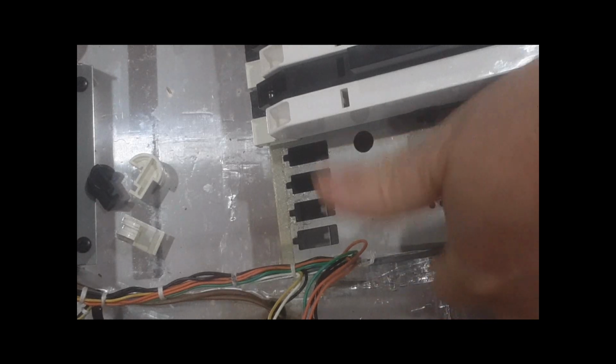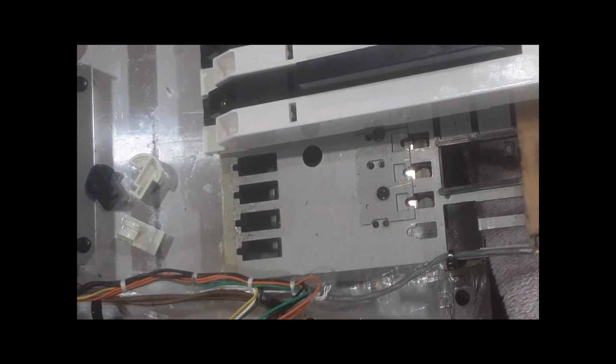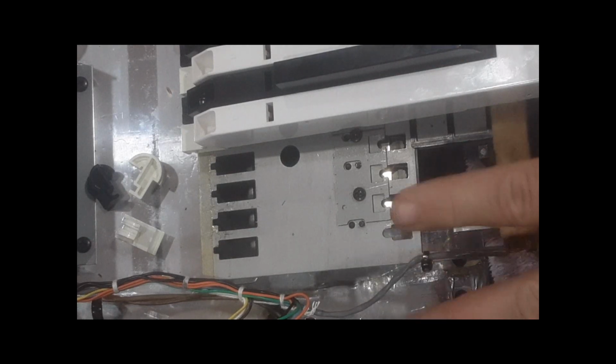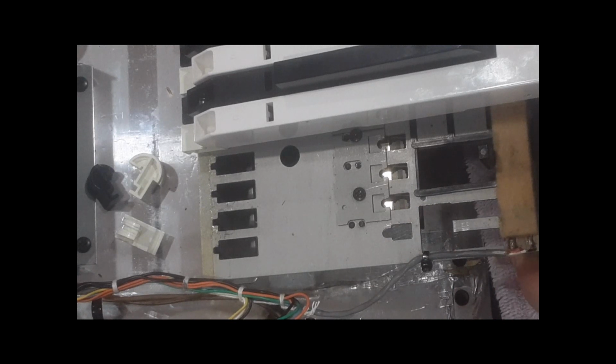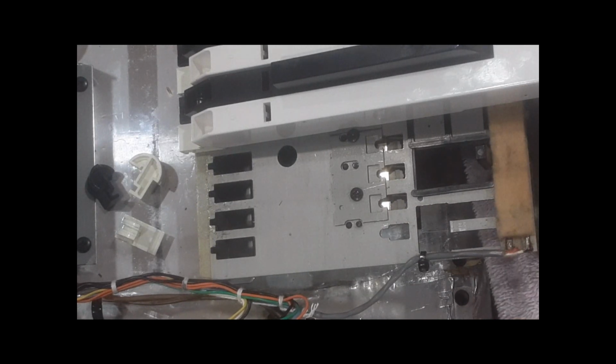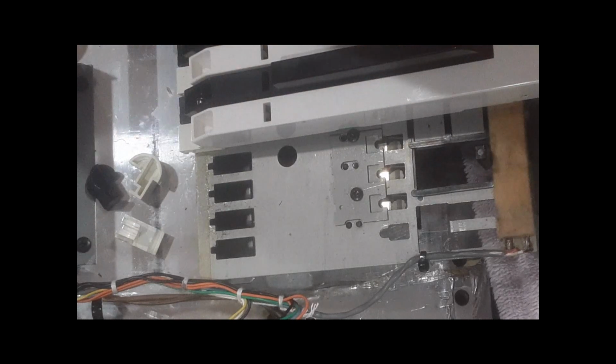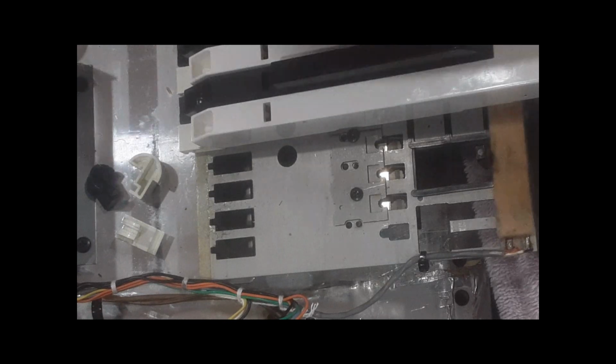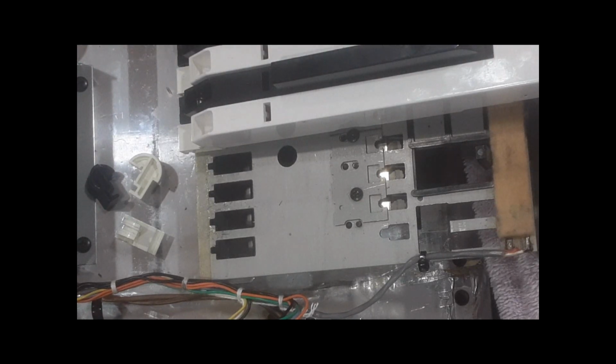That's why I hate doing this, because in this video, I had this over the hook here, so it really hooked the keyboard down. But then you can't press on the black keys when I'm going to have to show you. So when you put this up on your towel, put this U section right on top of your towel. Don't hook it over like I had before, which was safer. What you could do, if you really wanted to, is take your wood screws and put 3 wood screws temporarily down there, and that would lock this in place. There are no screws there, but that would be nice, because then this wouldn't slide down. Of course, there'd be 3 holes in there, but you wouldn't see them once you put it back together. So that's a solution where these 3 brackets are, where you took the 6 screws. You could theoretically put a little screw there.